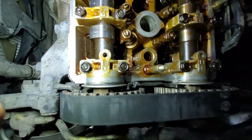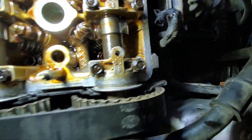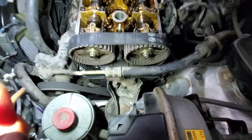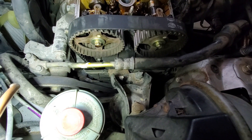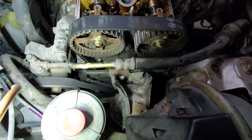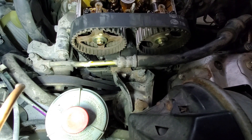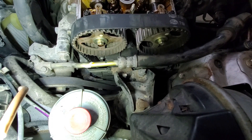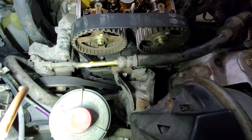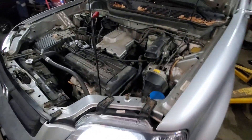The locking pins are lined up so the timing is set, and I didn't even have to take the timing cover off - which is awesome because it saved me a whole bunch of time. I got the valve stem seals changed over without having to pull the cylinder head, and that was the whole idea of using that tool. This job went by a lot quicker than taking apart stuff that didn't need to be taken apart. Hope this helps - she's all back together and running.